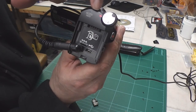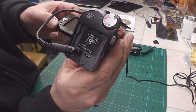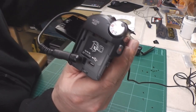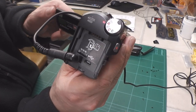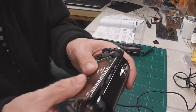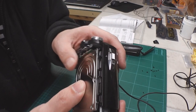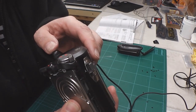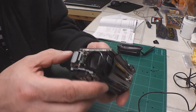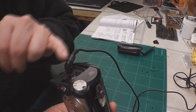I'll have to read the manual. I just noticed — you've got the power lamp there, and when you flip the LCD and it goes off, you basically get a flashing green light, which seems like it's going into a power save mode of some kind. A quick read of the manual confirms — you can basically turn the camcorder off and on by closing the LCD. In this case it's not powering down completely, it's just going into a power save mode. I presume it would power completely down if I was using a battery rather than a DC input.